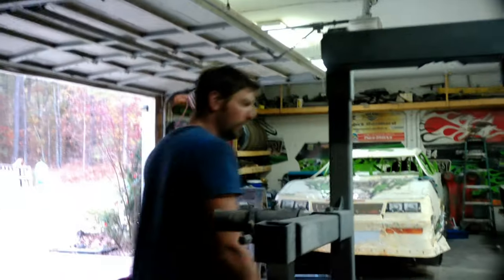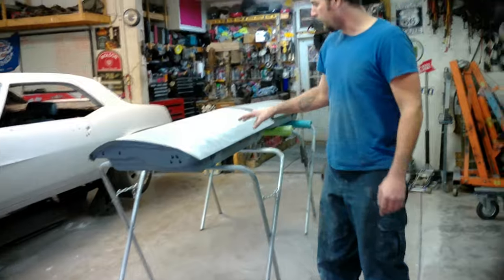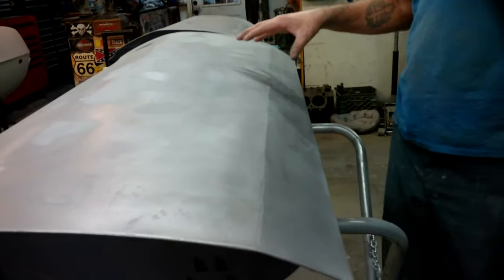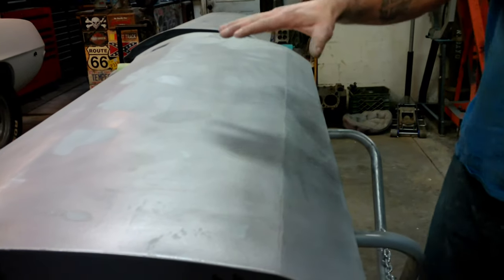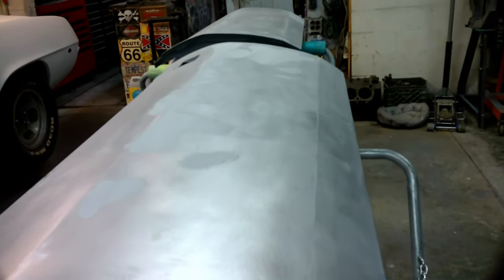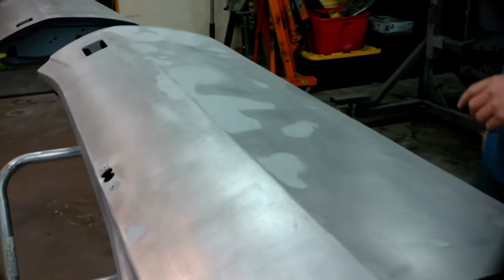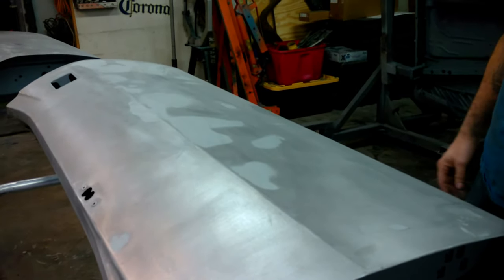We'll take a look at the doors — I didn't epoxy them yet, we're going to epoxy them today. While we had it bare metal, the doors had a bunch of dents on this whole area. What I like to do — the car was a big project — I like to get the dents and the rough body work done before we epoxy it. Then I like to put my all-metal on, where most of the major metal work is done on the doors. They're all pulled out and I skin-coated with the all-metal. We'll epoxy it — I think it adheres better to the bare metal, so that's why I do it that way.